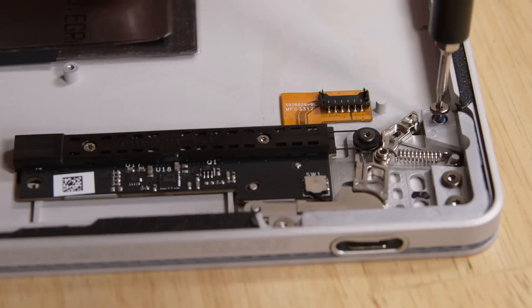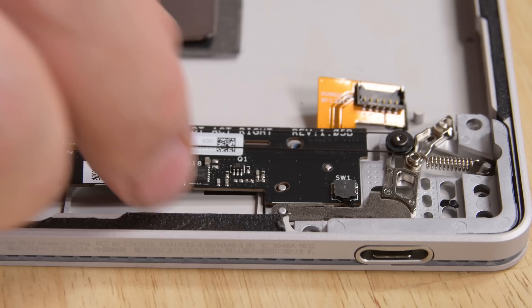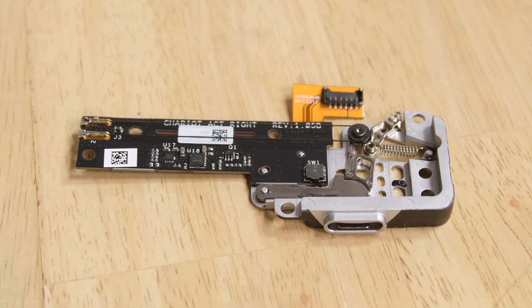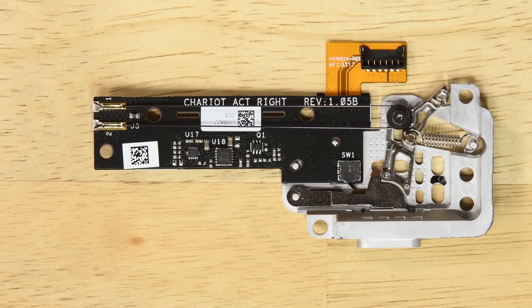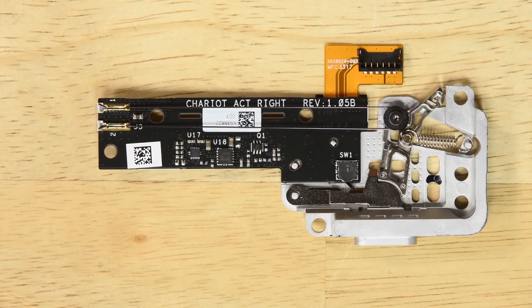This makes it extremely difficult to disconnect the power when attempting a repair. Lastly, we have the very cool docking mechanism that keeps your tablet secured to the keyboard when you're in laptop mode. This is the same system we saw in the first Surface Book, and it uses a muscle wire lock. When electricity runs through the wire, heating it up, it contracts, which pulls the black pulley inward against the spring, lifting the lower arm of the linkage. That lower arm holds a very tiny rod captive — the rod serves as a grip that holds onto the base unit's metal tab. When the linkage is retracted, the rod rolls out of the way and lets the base go.